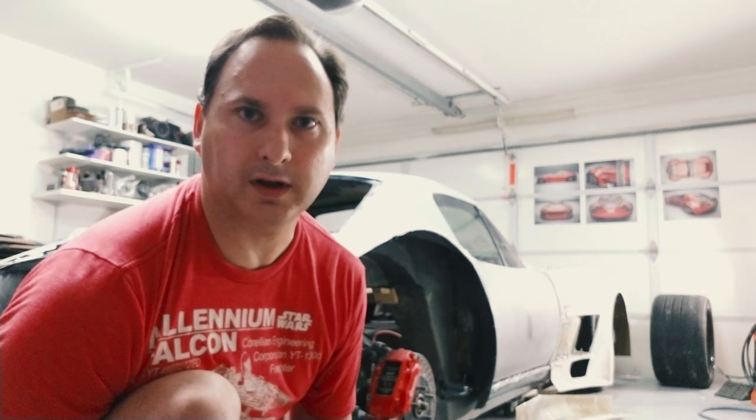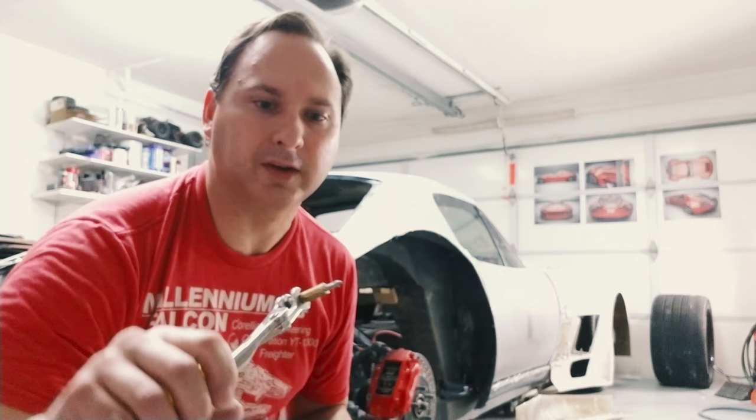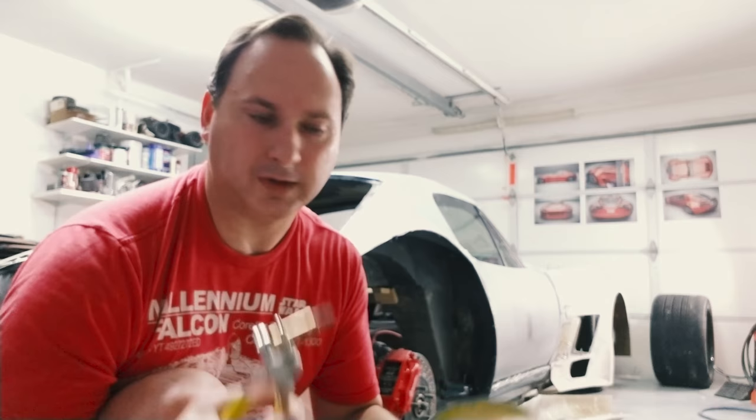One little trick: since I'm working with pretty strong epoxy and using these pins, to make sure they don't get stuck, I squeeze them out so the rivet piece comes out and I dip it into pure carnauba wax — just enough to coat it. That way when the epoxy cures, I can pull these back out and they won't be bonded in with everything else. About a couple hours into the curing time I'll come through and give them a little twist just to make sure they're free.